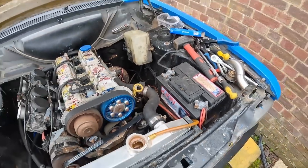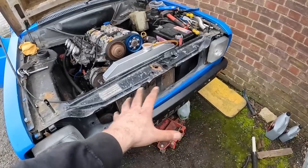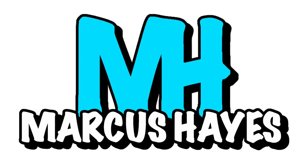I can't see any leaks so far — all looks good. I still need to refit the grill. I took it out of the way just to make it easier to do my bodge-up radiator clearance job, but hopefully all will be well. I'll bung the grill back on, tidy my tools, and then I'm going to go get something to eat and take this thing for a rip. Well, the radiator didn't have any leaks, which is unusual — normally when I do a job like this I have to nip up a couple of the jubilee clips. I let it run for a good while while it was jacked up with the radiator cap off just to bleed out any air bubbles, and everything's sweet.